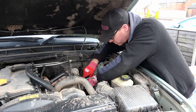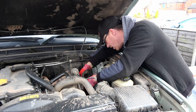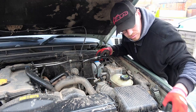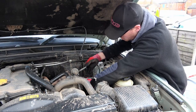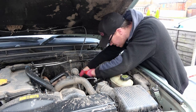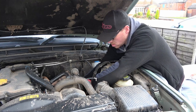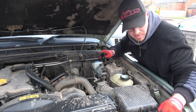There's two on this side, just behind the turbo, to the cold side of the turbo. Long one goes at the front. Another long one goes at the rear of it at the bottom. And the top one should be a short one — yep, the short one goes at the top at the back.